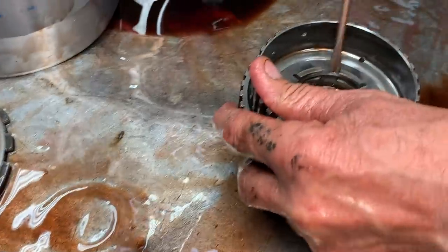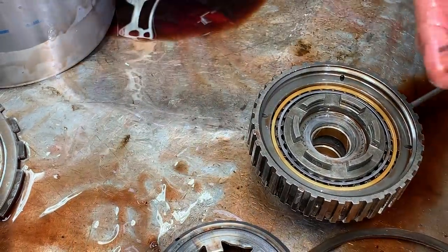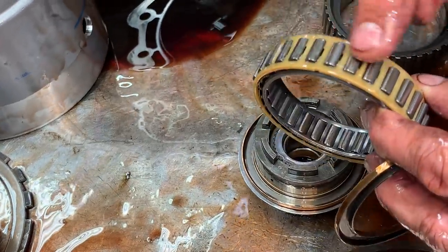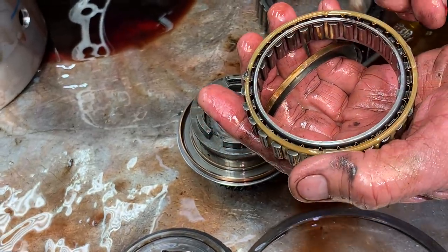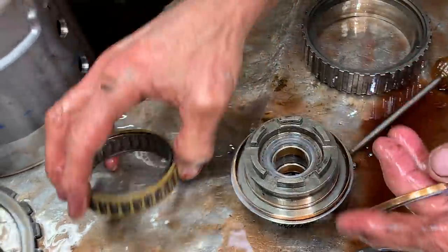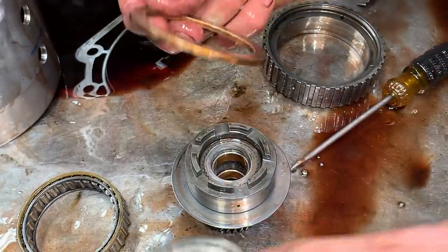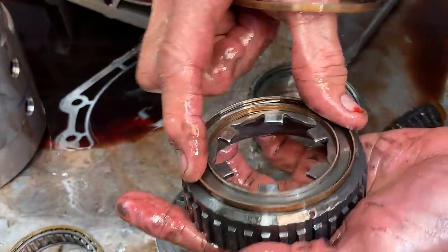Look at this sprag assembly here real quick. Now that's crazy, they still use this brass sprag, but they do. They went to a plastic body though for a while and got rid of the metal body, but did you notice this is a dual cage like the metal one that we put in there? Well, this is a GM dual cage sprag. So GM did start getting a little smarter and start putting them in there in the later versions and helping, but they stayed with this brass washer. I don't understand why, because this outer brass washer always wears like crazy. And when it does, it don't affect this hub that much, but it wipes out the washer. This thing got a big old lip on it right there. It'll just lock right in there.